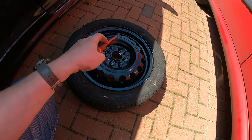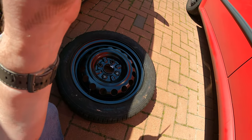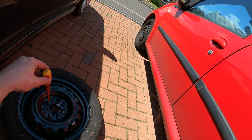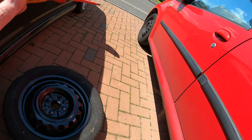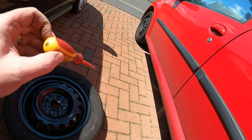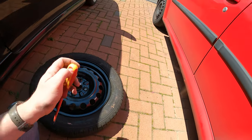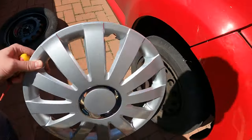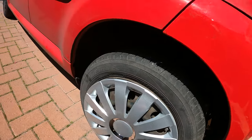Right, so some good news. I got the spare tyre out of the boot, and that's a Continental. So I'm going to take the unmatched front tyre wheel off, pop this one on, and then we'll have a pair of Continentals on the front, and that can be the spare, because you should really run matching tyres on whatever wheels are driving the car, and obviously the front's most braking as well, so ideally should be matched. So I'll get this fitted, and then we've got a lovely set of budget wheel trims to go on, which will really transform it and make it look tidy.